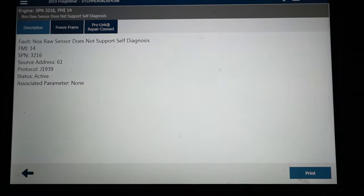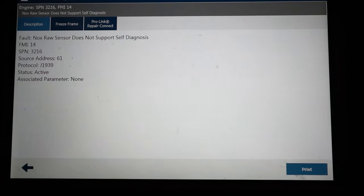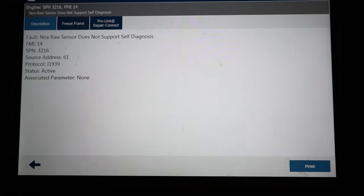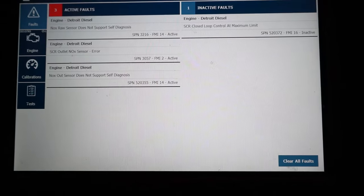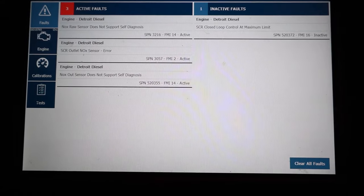I've got another machine that we're actually going to hook up directly to the NOx sensors and test them standalone, to see if they're bad or not before we just throw one on there — because they are quite expensive these days. So we'll go take the steps off to the other side and hook our other machine up.